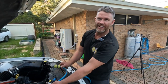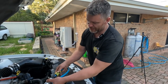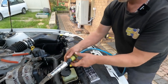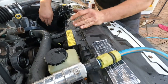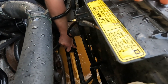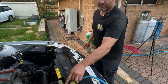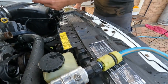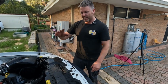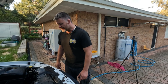The radiator's had a general squirt out. Now we'll connect it up to the flushing tool which has got a little valve on the bottom. What can we see coming out of that bottom hose? Sort of muddy-ish. I'm just going to let that flow until it comes out clear. It's got a little air fitting here so I'll connect the airline to that and give it a burst every now and then - that'll give the block a bit of a shakedown. Then we'll put it all back together, put some water in it and that coolant flushing agent.